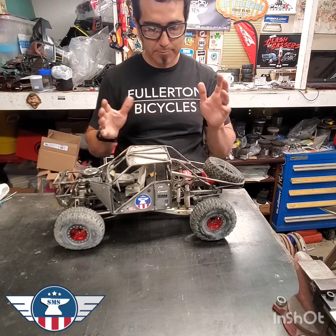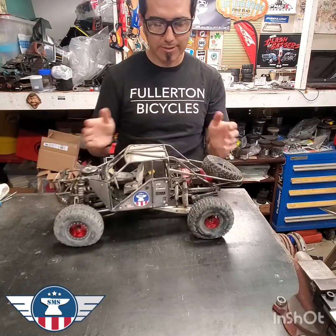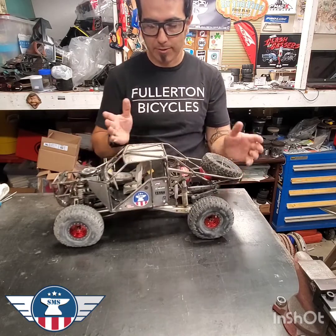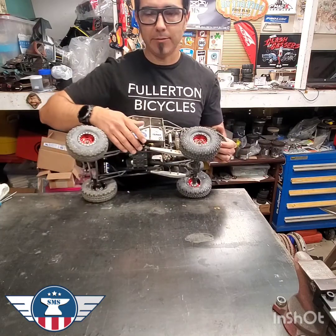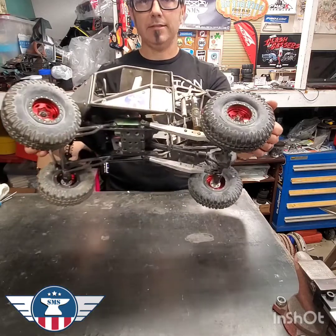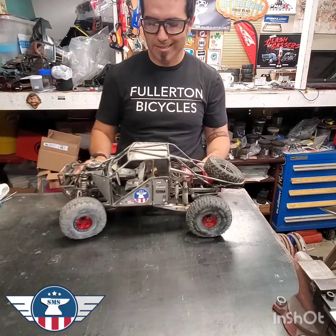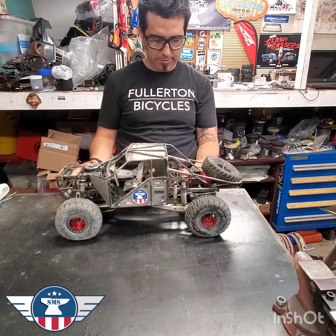So this has bomber trailing arms on it. I wanted a little bit longer trailing arm, mostly to have the space to put these shocks and get them nice and even. The ones on the Gatekeeper were a little short for what I was trying to do here, so I used the bomber ones. No special mounting required for those bomber mounts. You just mount it to the same hole as the skid plate mounts to the frame rail. I think it's the most inner hole. And that keeps your wheelbase about the same as the Night Runner, I believe.